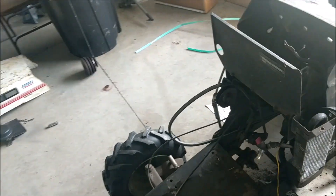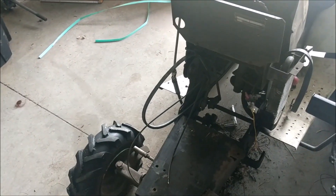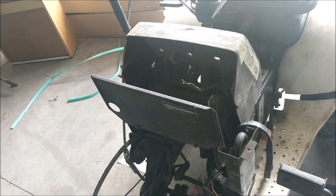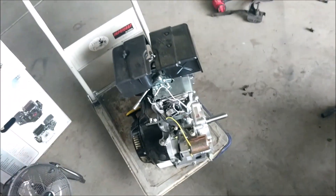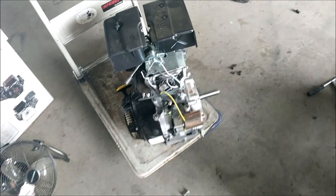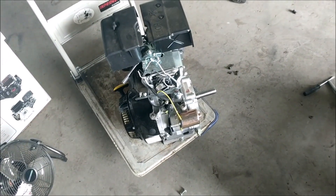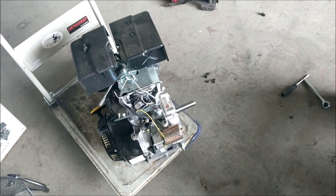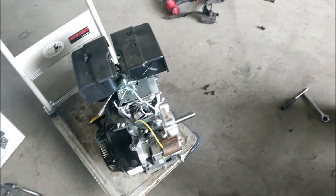What I'm going to do is set the engine in there and get the holes drilled up. The other thing I'm also going to do is put an electric fuel pump on there, which I have on order — they just need to show up. And then a car alternator, because the charging system on these suck; they're basically good for nothing. So I have a car alternator laying around and I'm going to put that on there.